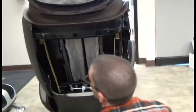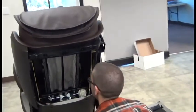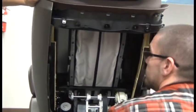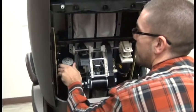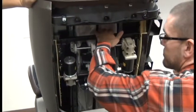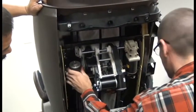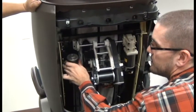Pull out from the side. Once you have the opening, tell the massage mechanism to travel up until it gets to this gap — the mechanism will fall out when it hits that top gap. Find a spot on the mechanism that's safe for you to control it without putting your hand directly on the top. This motor might be a good grip point — just make sure you don't grip from the top, and go as slow as you can as you get near the top.